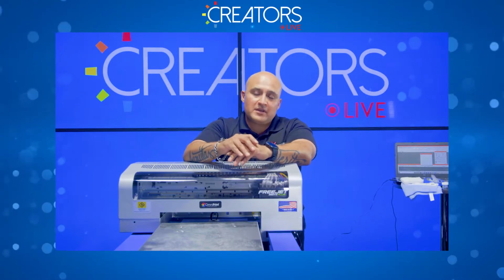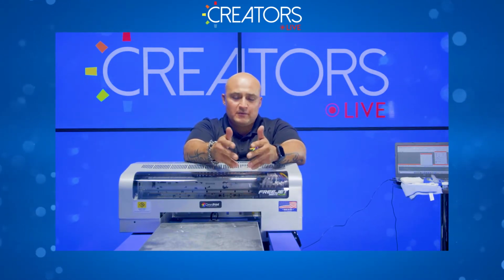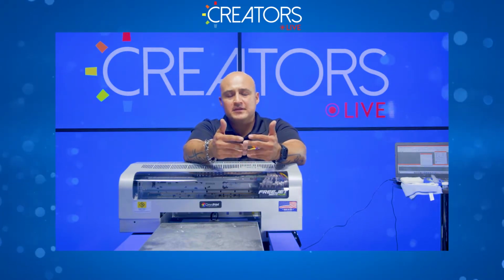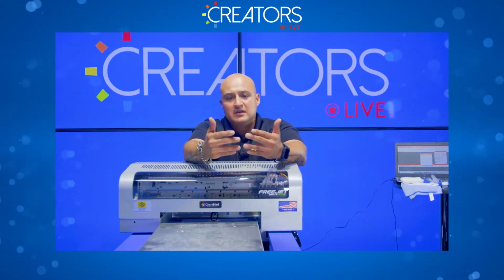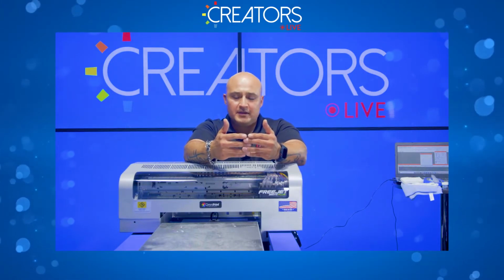Now humidity. When we're talking about humidity, you're going to be bumping into printing issues. And what are we going to be facing? Pretty much it's going to be banding. If the humidity is too high, the ink is not going to be able to settle the way it's supposed to in the garment, giving you the end result of banding. That's the first thing that you're going to be able to notice.